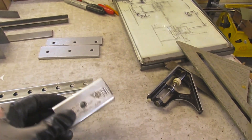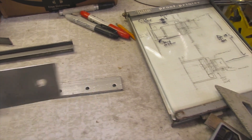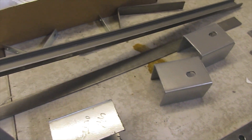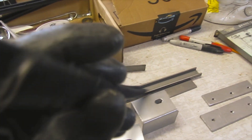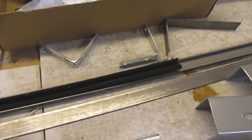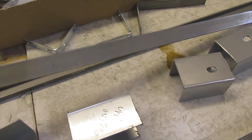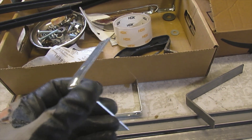I've already prepped that a little bit and I'll show you where that goes. Some pieces came with the hinge kit — these are nut plates, threaded nut plates that'll strap onto the hinge. There are some filler pieces meant to attach to the door panels. I'm using a half-inch by one-inch eighth-inch regular C-channel for the actual window runner track. Here's the window track I bought — I initially mocked it up without that, but this is great to have. It will stick right in there, adhered for the window run channel. Some miscellaneous one-inch flat bar, eighth-inch thick for making brackets, and I've used some off-the-shelf shelf angles.